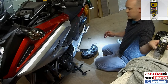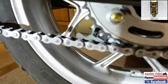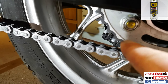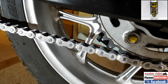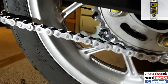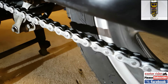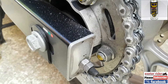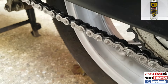That's all done — about a ten-minute job overall. I'm just checking my rear sprocket to make sure it's not got shark's teeth — that seems fine. I've only done three thousand miles on this bike so I'm not expecting any issues. The chain looks like new now, looks really good. Normally I wouldn't need to degrease the chain, but the previous owner used really thick oil, so I had to get rid of the old stuff before putting the chain wax on.